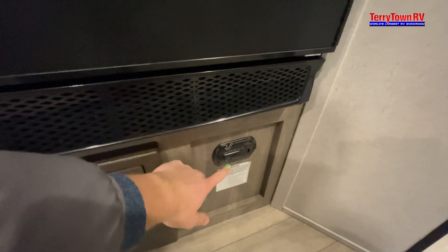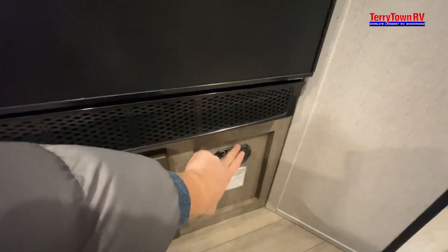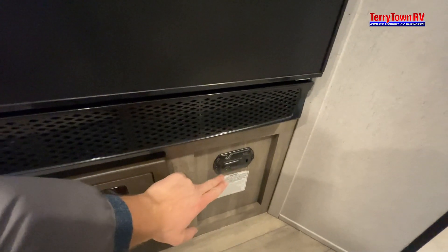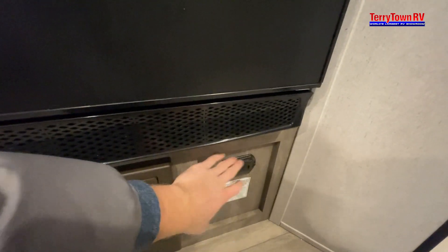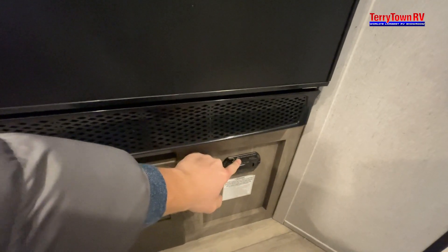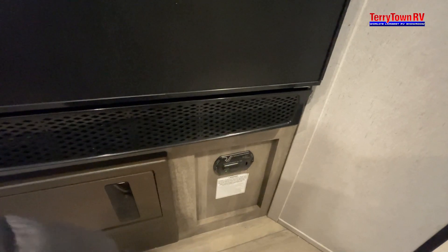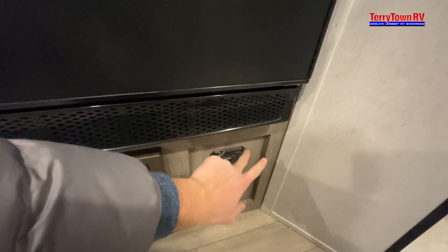For your carbon monoxide detector, the little green light indicates that it is on and checking. The downside is that this never turns off — that green light never turns off, even if your battery disconnect is off or it's unplugged. It will still draw power and will end up killing your battery. So what I recommend is, if you're going to leave your camper for about three to four days, go ahead and unplug the negative end off of your battery so this will finally stop drawing power.